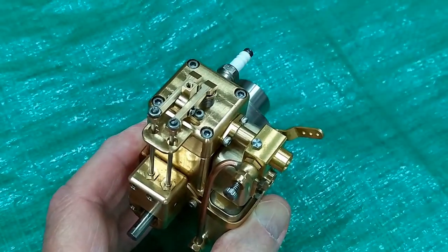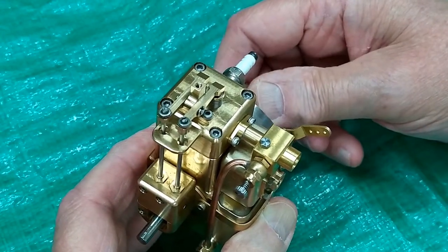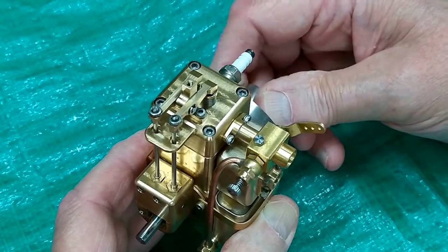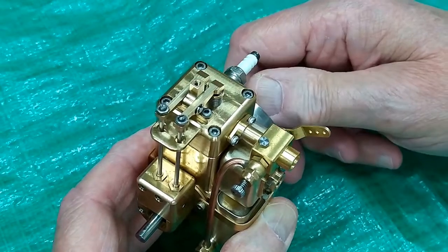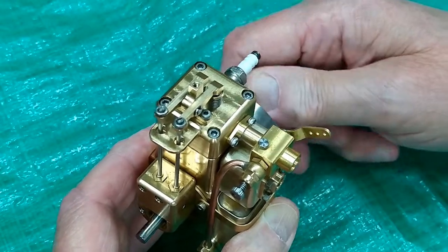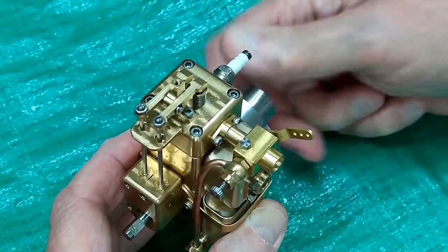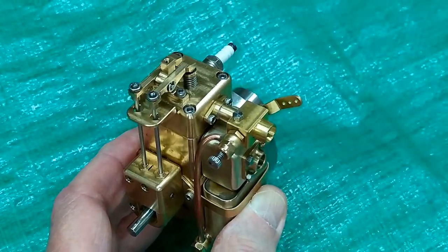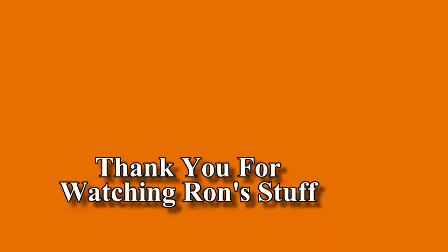You have to get everything back together. This is your mark on the crankshaft right here, and we're rocking back and forth on either side of top dead center, and these two valves are moving. That's the end of the exhaust stroke and the beginning of the intake stroke. If we come all the way around, then we're on compression. So hopefully, if you've gotten those gears timed correctly, the engine will run.